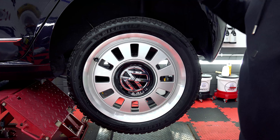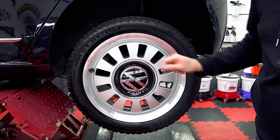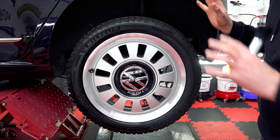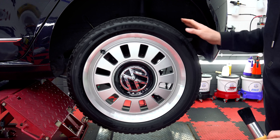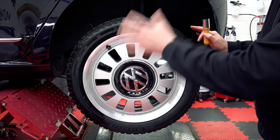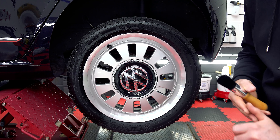As you can see, it is very glossy compared to something like Tyre Coat, which is more of a satin finish. This will actually dry in, so I would always recommend leaving it for about 15 minutes, ideally 30 minutes. Leave the car standing and allow it time to dry into the tyre correctly, at which point the gloss will increase as well. If you do not like a glossy tyre and want to bring it back to more of a satin finish, you could take a microfibre cloth and just wipe over the finish, which will dull down the shine a little bit.